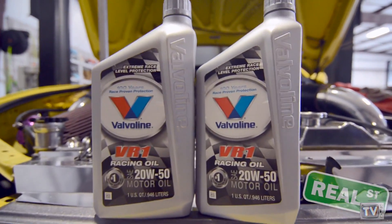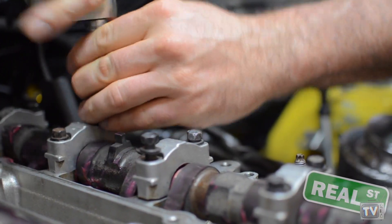I typically use a thicker motor oil or a break-in lube on the lobes and on the journals, because if the camshaft has not been run before, it's important that it's not run dry.